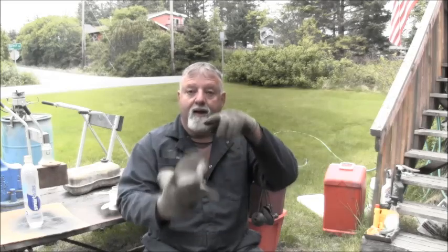But what I'm thinking is, it depends on the year, but sometimes during silver salmon season, around mid-August on, they come in here really thick, and they're easy to pick up trolling, but you can't be going too fast. You've got to just putt along. And I have my little three horse two-stroke, and I've got a little four horsepower Yamaha. But even those seem to push the boat a little faster than I want to go. So this one's an extra long shaft, and I thought maybe I could cut a propeller down to where there ain't much left, and put it in gear, and it might get me down to about 3 knots or so. It's either that or use my little two-strokers.